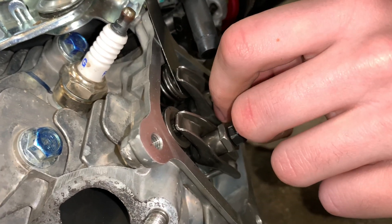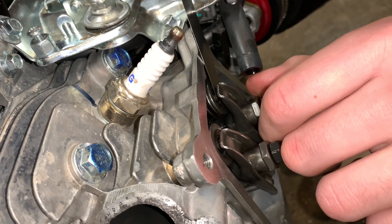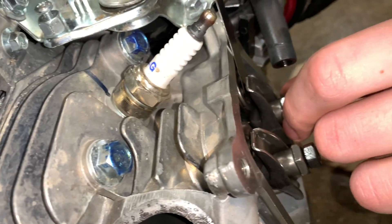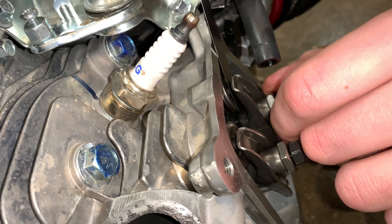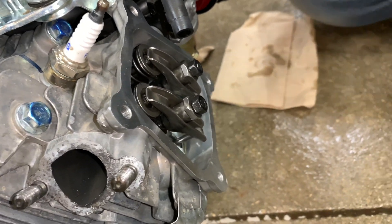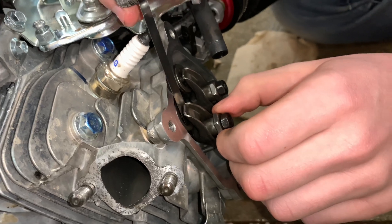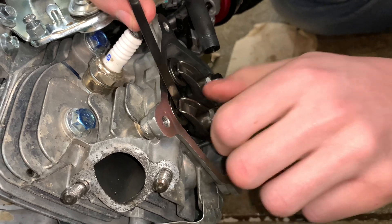After you get all your nuts hand tight on your fuel side, you're going to need to set your feeler gauge at five thousandths of an inch and adjust your back nut so you have a little bit of drag in between your rod and your rocker arm. On the exhaust side, spec calls for eight thousandths, but since the engine's cold, you're going to want it to be at about seven thousandths of an inch. Repeat the same process — just adjust your main nut until you have a little bit of drag on your feeler gauge.